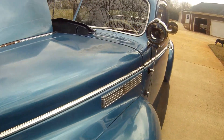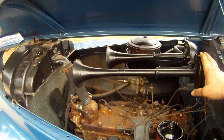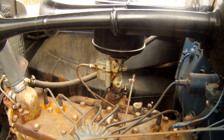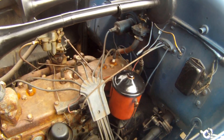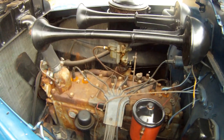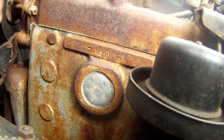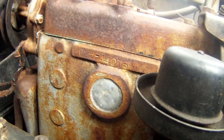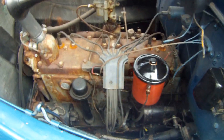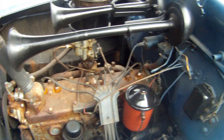You've got your horns here and the original 6-volt generator system and carburetor. There's nothing really disturbed under here — it looks all completely original. The key thing in terms of originality: on the stamp pad it has C25-41015, which matches the VIN of the car and the VIN on the title. So this is the original block that was born with the car in 1940. The motor runs super, doesn't smoke, doesn't leak oil. You could run and drive this car anywhere as is — and I have.